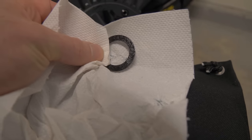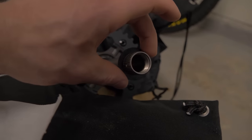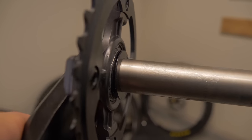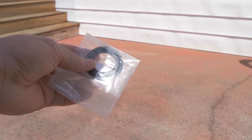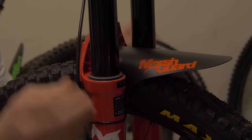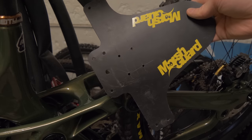When it comes to the issue of my cranks and the whole spacing issue, I talked to my local bike shop about it and they gave me these little shim spacers, and that actually seemed to fix the whole problem. This little spacer is 1.5 millimeters — they gave me two of them. I put them both on the drive side and now the chainring can spin freely and has good clearance from the chain guide. I got my local shop to install the whole drivetrain for me. I actually ended up getting a crown race off of my friend since my shop had to put it on backorder. I'm also sticking on a couple of mud guards here to protect from the mud, and I cut in a couple of new holes for the rear fender since I couldn't use the existing ones.